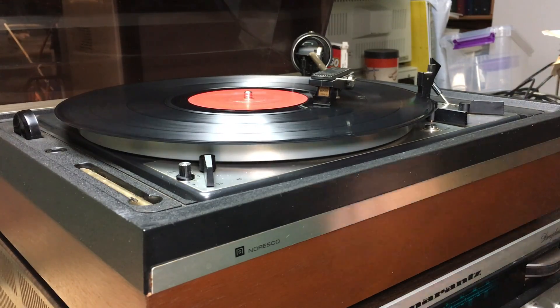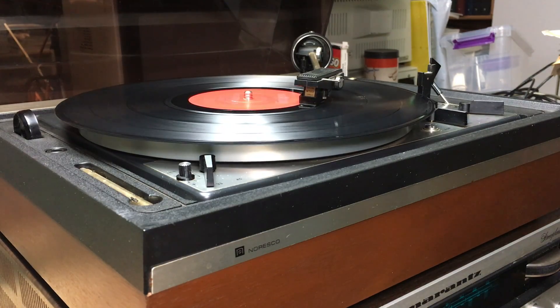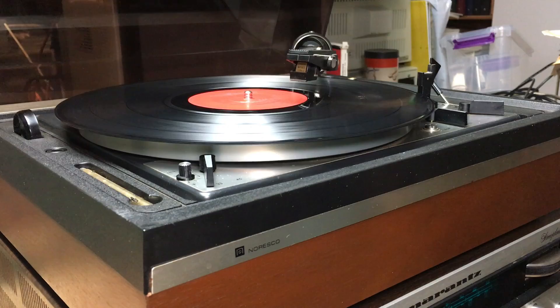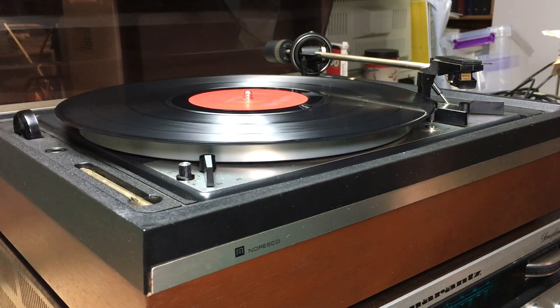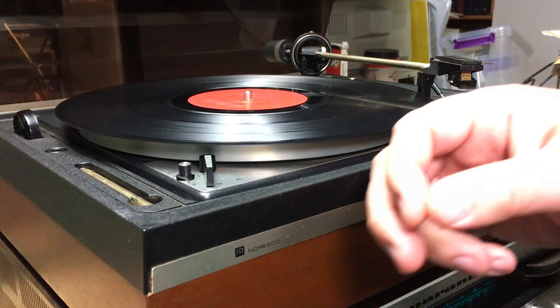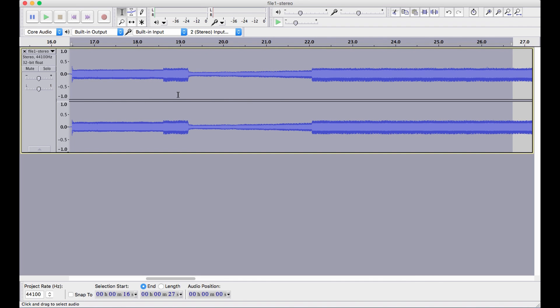It's interesting how the volume dropped down so much there. This is a pre-long track — it won't make you listen to the whole thing. And there it is — about a minute forty. I've got that capture in Audacity. You can see there's quite a big volume drop. The first section is a header, and that contains the file name. The next section is the actual program. And there's quite a big dropout in the volume here, which might be a problem.